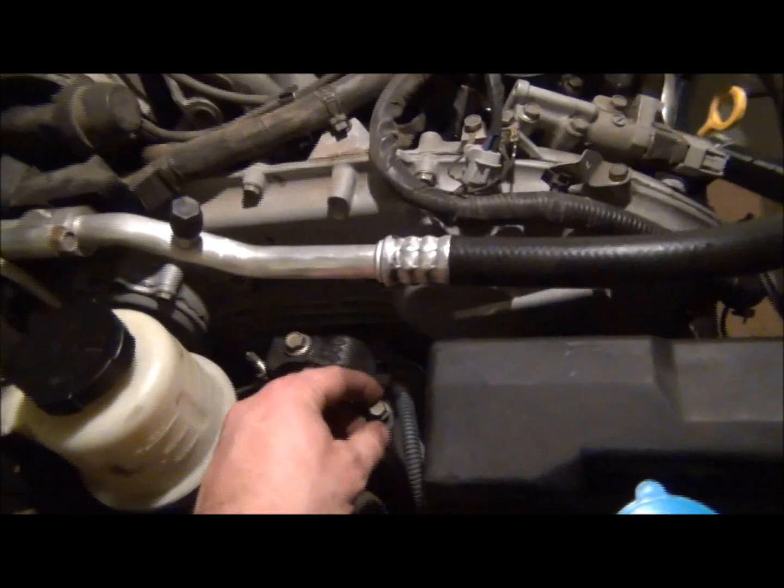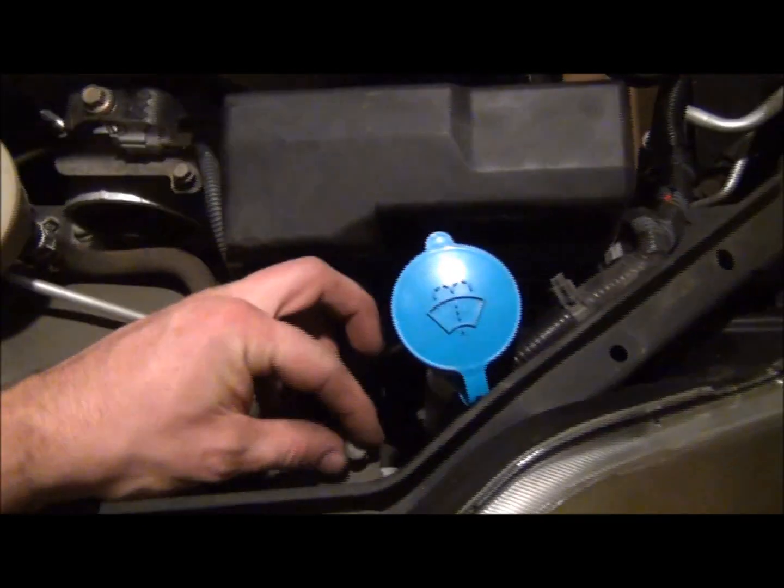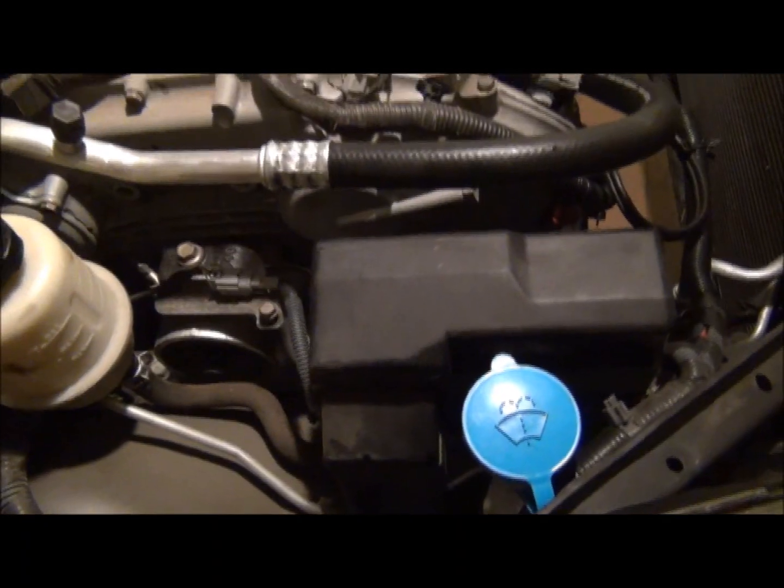We had a hose going across here to, I think, the top of the radiator. A couple 10mm heads, and this thing slid right out, no problems. The 10mm heads, there's one here, bolt here, and a bolt here. I just screwed them back in so I don't have to worry about where they were. Pulled that out, and I think that catches you up to where I'm at.